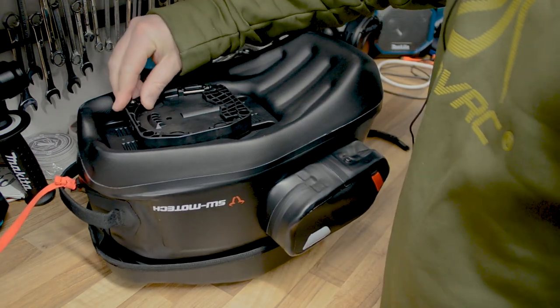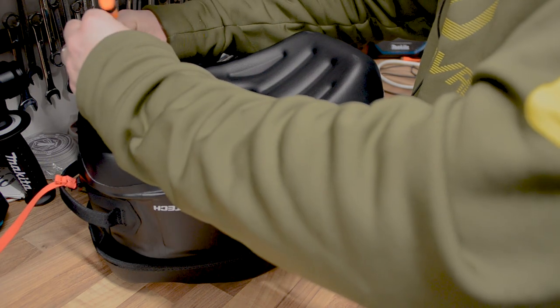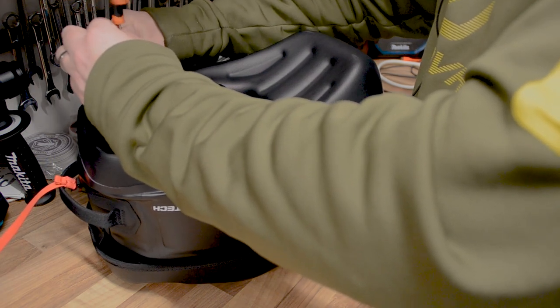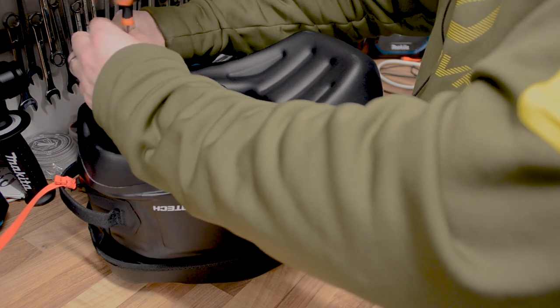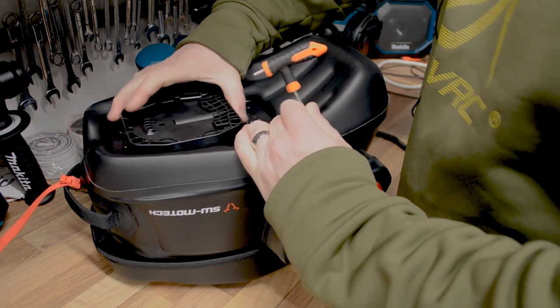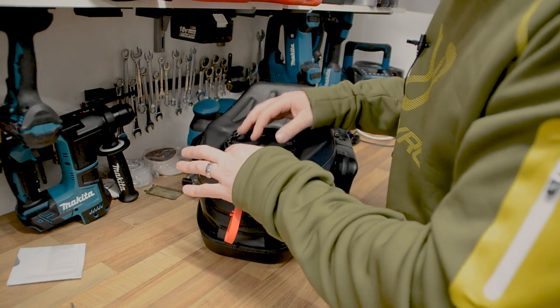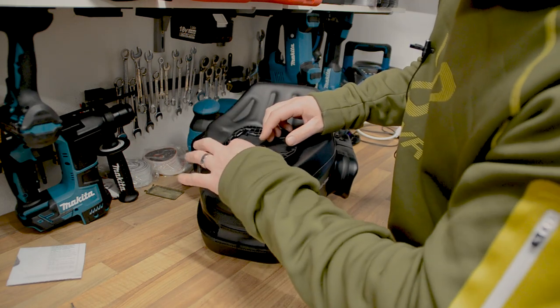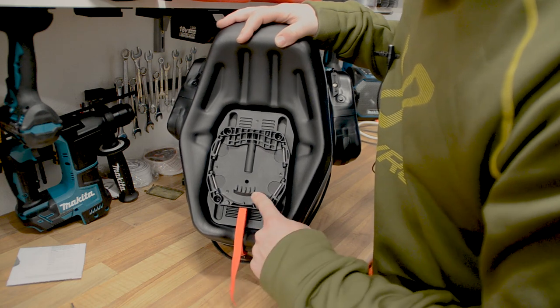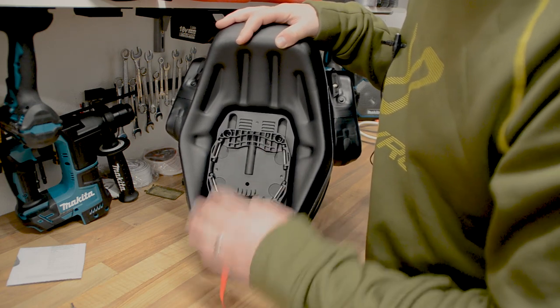The position you need depends on the shape of your tank. Before going to the bike to test and adjust, make sure you've installed the release cord into the front of the base plate. There's a little loop on the base plate which you push the cord through — when you pull down on it, it releases the mechanism and frees the tank bag from the filler cap. If you forget to install this cord while testing, you'll have a nightmare trying to release the tank bag from the bike.